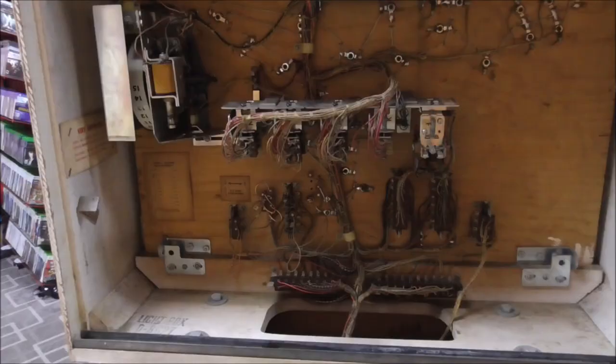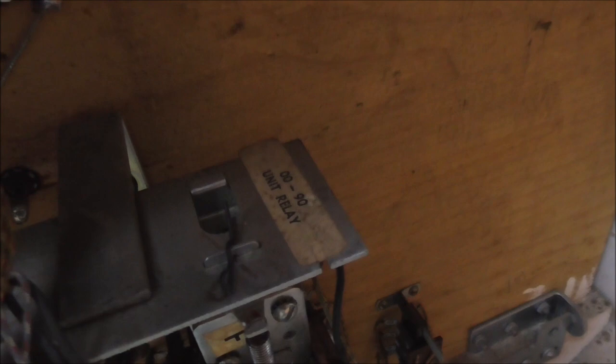Cleaned the Jones plugs and put them back in. I took out the match unit F - that's the zero to ninety unit relay, which a lot of people call the match unit. I cleaned these four relays, which are the point relays and such, and cleaned the switches on the replay unit. Now we're up to the very top - we've got these eight score reels to rebuild, and then we have what I think they call the player unit.